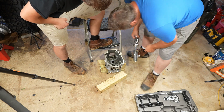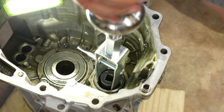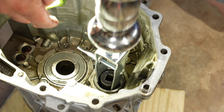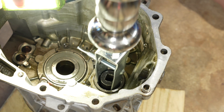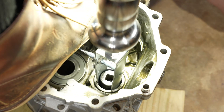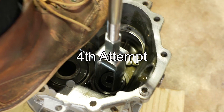We finally moved the bearing — got it up some. We have the puller I originally bought but we're not using it. I'm using an OTC — a much bigger puller, probably three times the size. It did thread into the shaft. We've got a 21-millimeter socket in there as a spreader. I think we're going to get it out. The $110–$120 puller's jaws are not faring out too well, but it's pulling up.